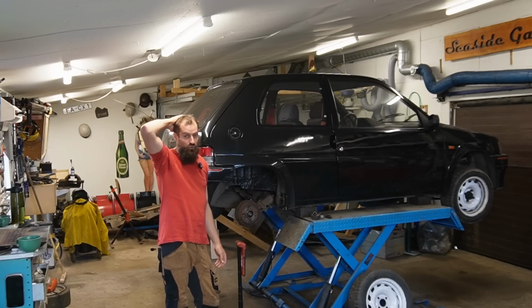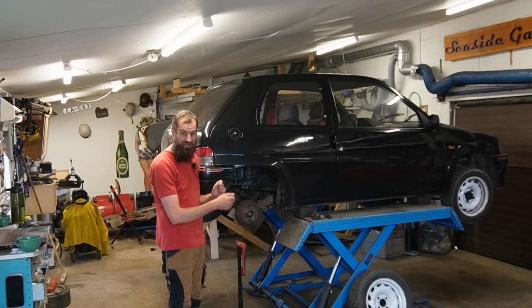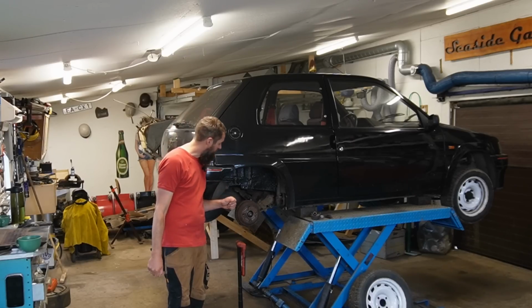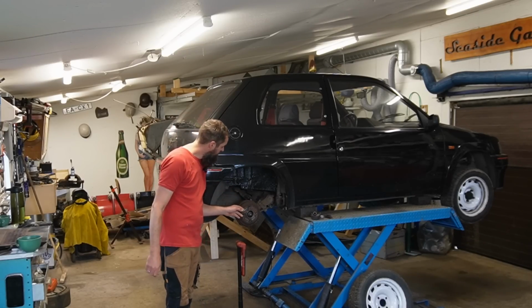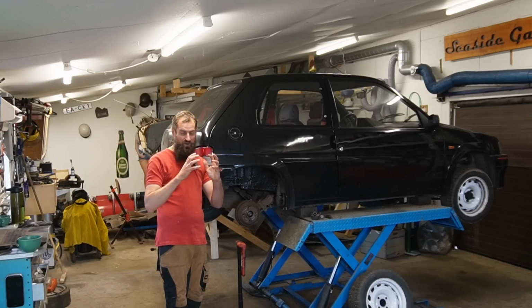What I ended up doing was just to set the brakes up as good as I could. I rechecked the handbrake mechanism. I adjusted that to spec. It needs to grab a little bit at fourth click by adjusting the cable. I adjusted the drums out all the way as far out as I could get it.